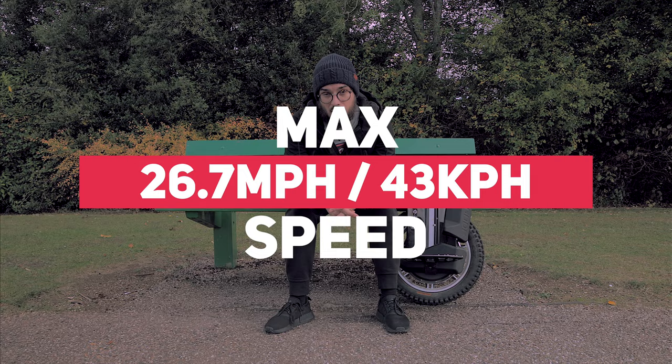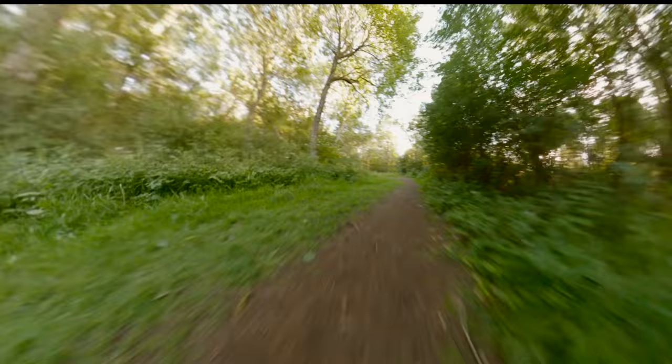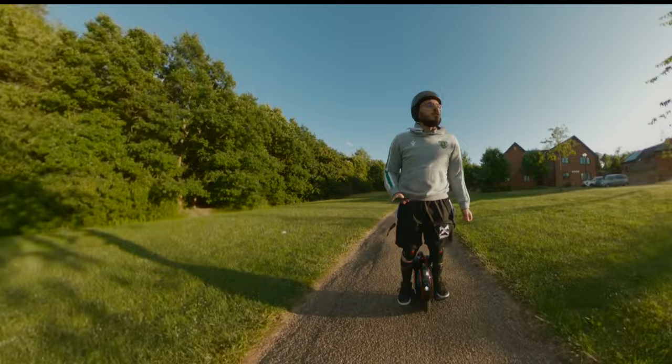The smaller the tire, the more unstable it is — that sensation where you almost don't change the position of your body and you're accelerating and braking almost at the same time. So having a tire that's slightly bigger, going from 10 inches to 11 inches with a knobby off-road tire, you're going to feel that sensation a little bit less on the M10-4.